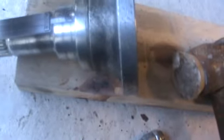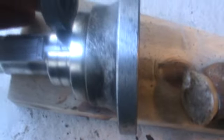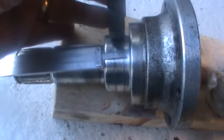Can you see that? It's just short of the face there. The oil seal - that is where it's sitting. You don't want it up against the face, because that face, when it's running, will run on that face. And you don't want that. It runs in the middle, roughly. So it's running about there, just slightly back from the face.